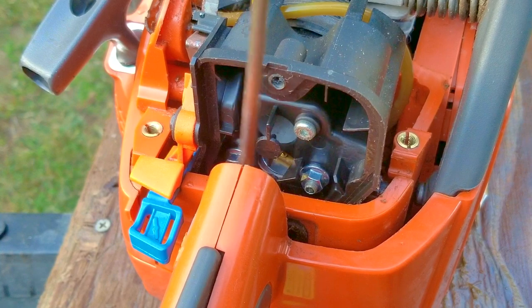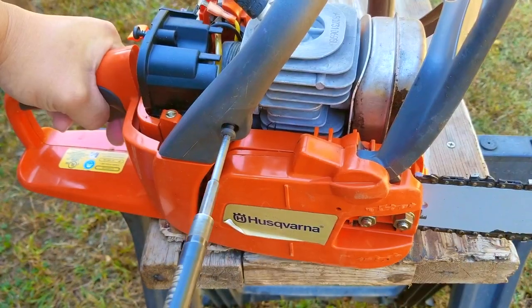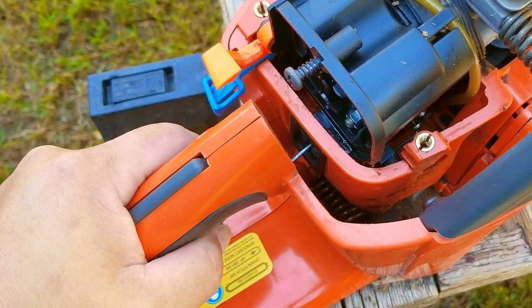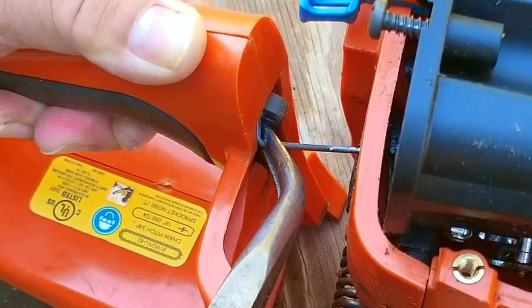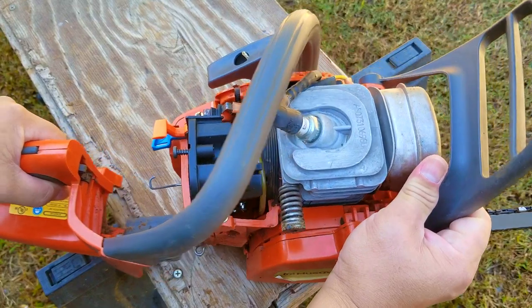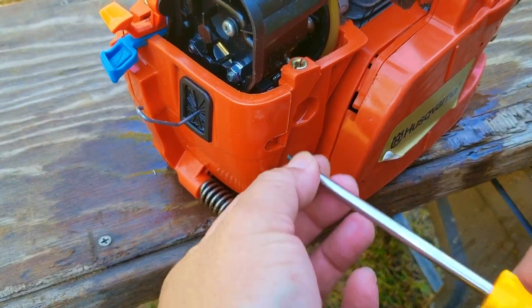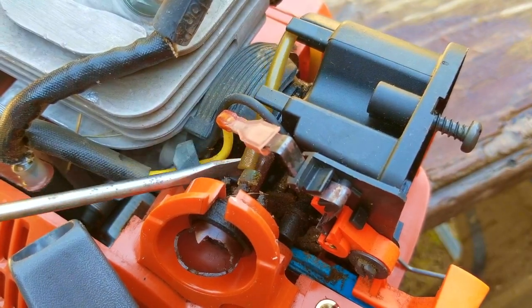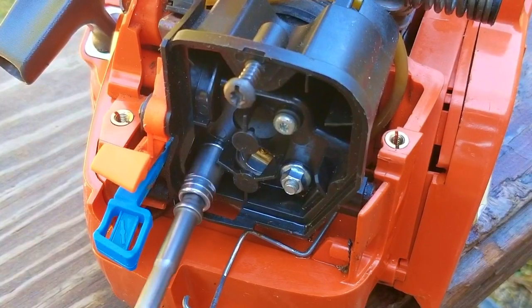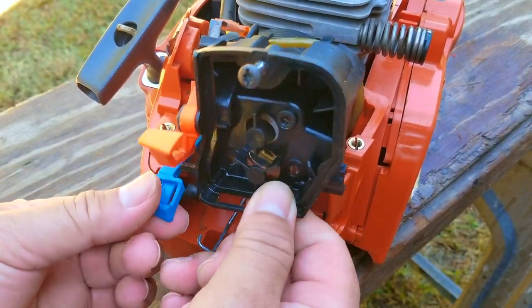This chainsaw is very interesting in its design. To get to the nuts that hold the carb to the engine, we have to take a few parts off the body. The first part is the entire handle section — the rear handle and trigger along with the front handle around the body. Fortunately it's easier than it sounds: remove three screws and disconnect the throttle linkage to the trigger, then carefully remove it. Once the handle is out of the way, remove the last screw holding the cover on to get a good view of the carb and the fuel lines. We didn't need to get this far to see that one fuel line going to the bulb was broken, but we did need to do all this work to replace it.